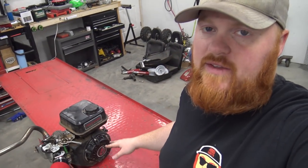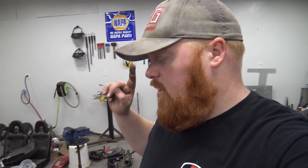We put some 18-pound valve springs in it, the Go Power Sports performance jet and air filter, an air filter adapter, as well as that header. So it should be a really good little go-kart engine for him to start out with. I mean, if he gears it right, he'll have another little Red. And if you remember how little Red is, she's mean.